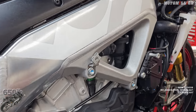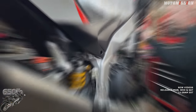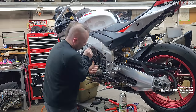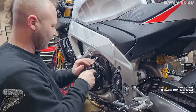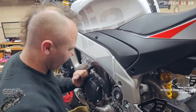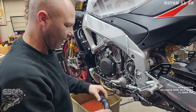That hose goes all the way up to the thermostat housing. There must also be a hose under the tank. These coolant hoses are on there tight — they really don't want to go anywhere. The clamps barely open up big enough to fit over the flange, so you have to spray silicone spray on the outside of the pipe to make it super slippery. This tool breaks free the suction with the pipe really well, but it still just does not want to pull off easily. All right, I think we can finally change one.